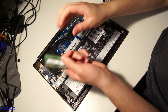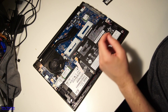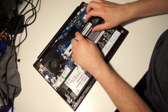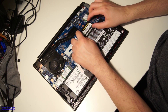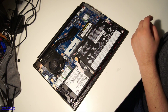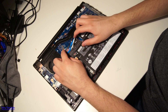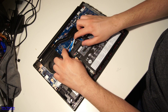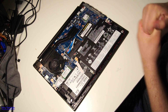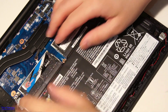To install new RAM — say I want to upgrade this 4GB DIMM to something a little bigger — you can take the first channel of RAM, slot it in, push it down from the top until you hear that click that tells you the clips are in. Grab the second channel of RAM, bring it here, and you get a second click, and you're good. That is both RAM sticks installed. This computer uses dual channel RAM, so you would ideally want two RAM sticks.